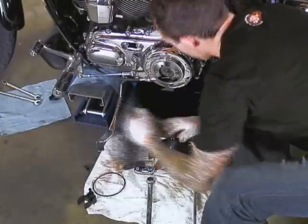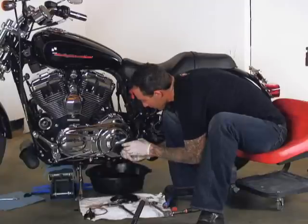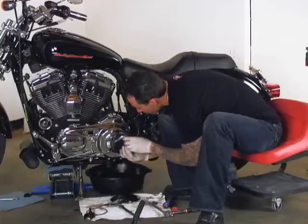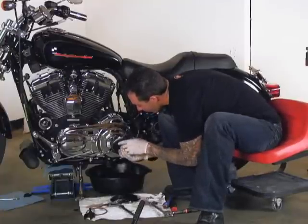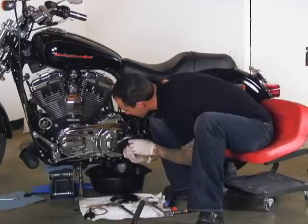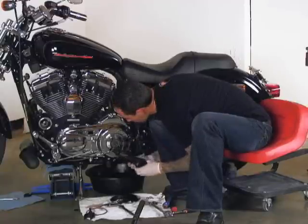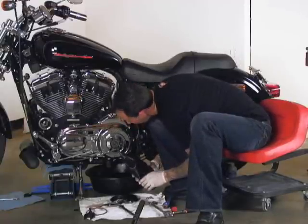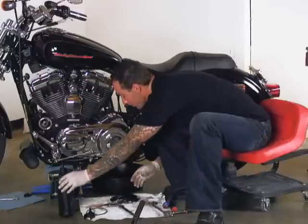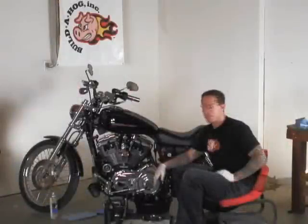With the plug installed, I'm going to go ahead and start installing our sport transmission fluid. We'll know when to quit when the fluid gets to the clutch diaphragm spring — that's the gray metal area around the clutch in the front here. Once it starts to touch the base of that, that's basically our level as to when to stop. The fluid has just touched the base of that clutch diaphragm spring.